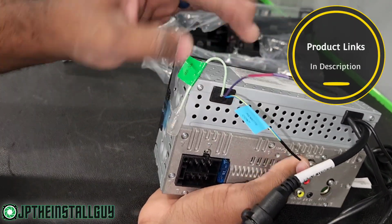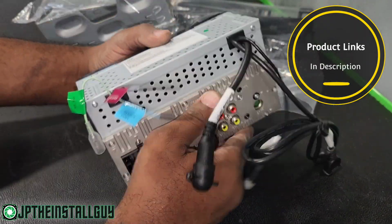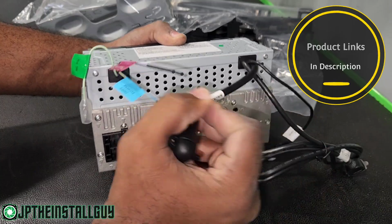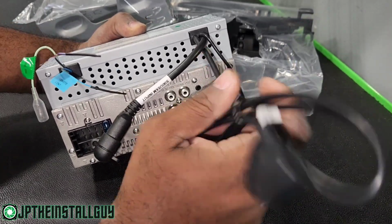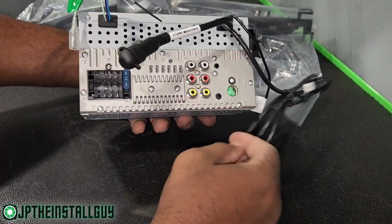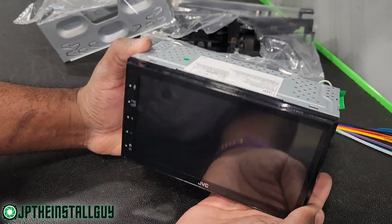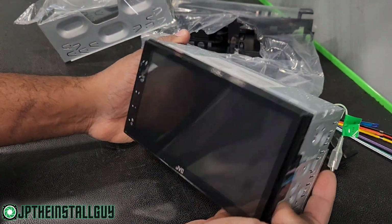This one right here, it is a shallow mount radio, so we love that. Sirius XM plug in the back right there for your V300. Built-in USB-A, 5 volts, 1.5 amp charging on that. And it is a 6.8 inch full touch screen, and it does have Apple CarPlay and Android Auto.